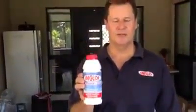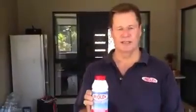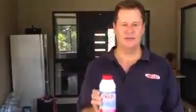Hi there, I'd just like to give you a brief introduction to this product called Uniglide Friction Reducing Concentrate. It's a 10W30 semi-synthetic oil designed to mix with synthetic oils or mineral oils. It goes into engine, diff, gearbox, petrol, diesel, manual, automatic, hydraulics, and the way it works, it's a metal treatment concentrate. Once it gets onto metal, ferrous or non-ferrous, you don't get it off unless you machine it off.